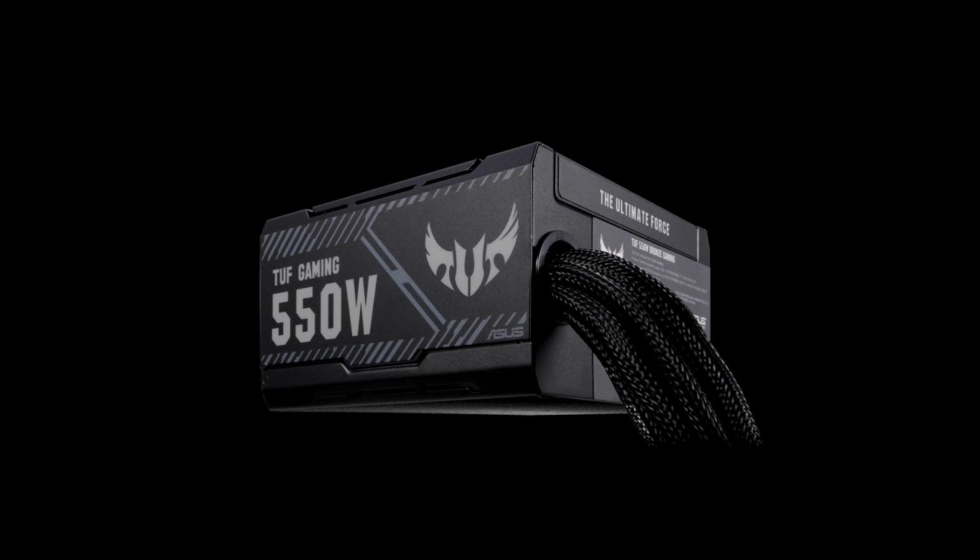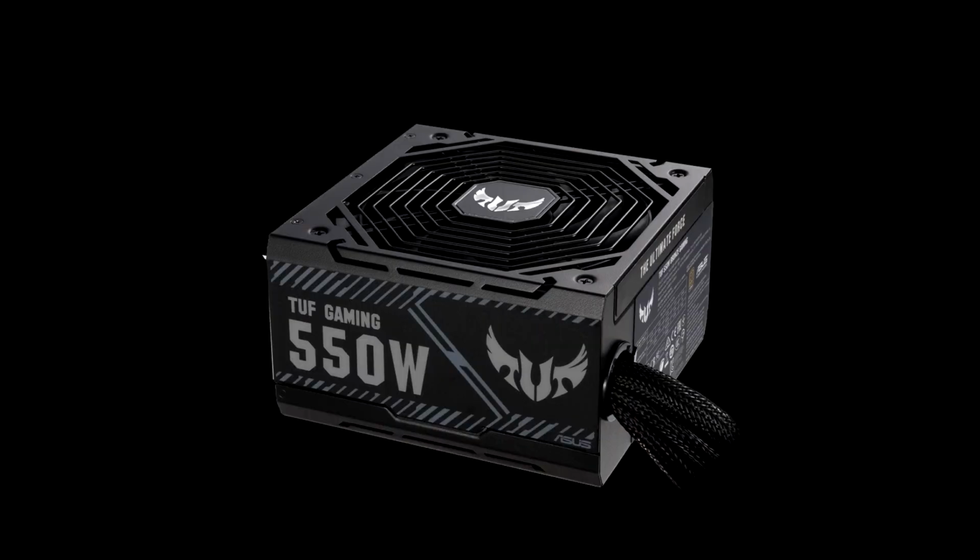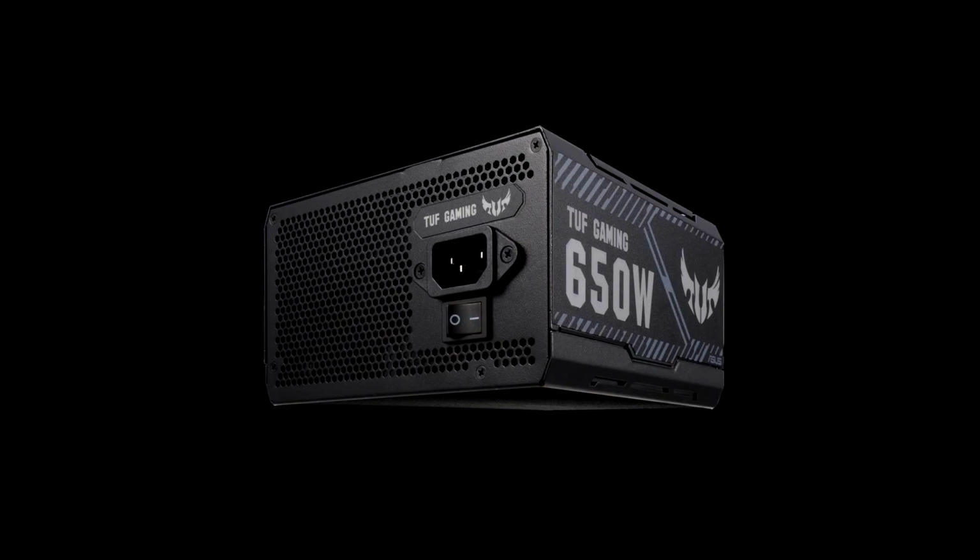Under the hood, the ASUS TUF Gaming Bronze PSUs feature single +12V rail designs, 80 Plus Bronze efficiency as the name suggests, and protection against over/under voltage, overload, overheat, and short circuit. Both models feature fixed, sleeved cabling. Both models offer a single 4+4 pin EPS, 24 pin ATX, 5 SATA power, and 4 Molex connectors.